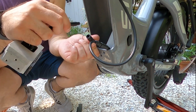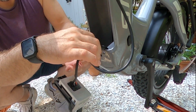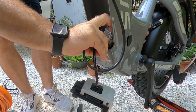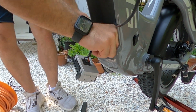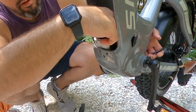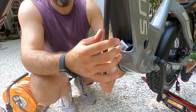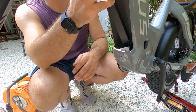Now my main focus will be ensuring that I have this run up so I know that my last connection is going to be my battery plate, but I've got to get my motor in there. So now I'm going to go ahead and get my battery plate on there so this connection isn't lost. Again, there are arrows on the face so utilize those. On the back side, run the motor through so I know it's catching. I'm just making sure that my wires run through the back as was the natural orientation. And then don't forget — you have this plate that goes in the back; you slip this into the bottom plate for the battery when you're done, and then it just shoves into the body that way.